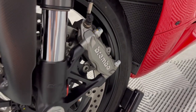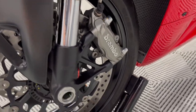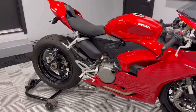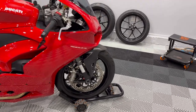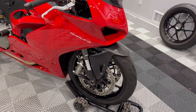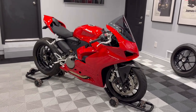One more quick thing: I like putting a little bit of anti-seize on the caliper bolts — just something I do. If you don't want to do that, fine. So overall, not too bad of an install. You're probably going to need a half-inch drive torque wrench for the rear axle nut, a three-eighths drive for the front axle nut, and either a quarter-inch or three-eighths inch-pound torque wrench for the pinch bolts. Caliper bolts will probably be a three-eighths drive torque wrench. So you don't need a ton of different tools, but there are some things that you do need.